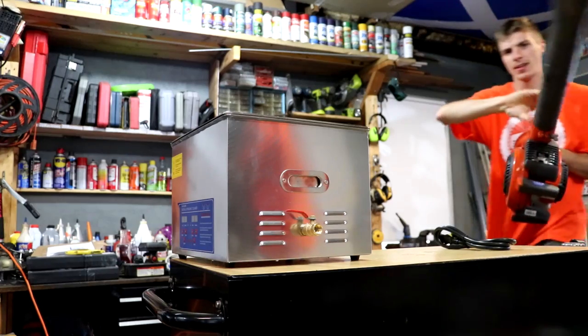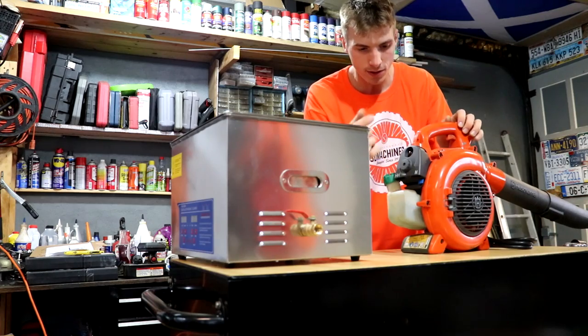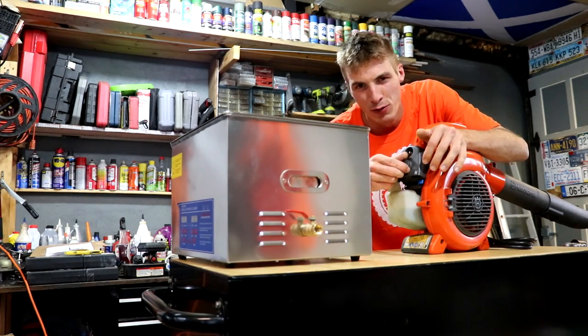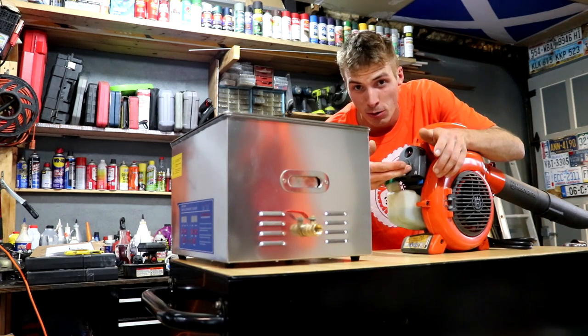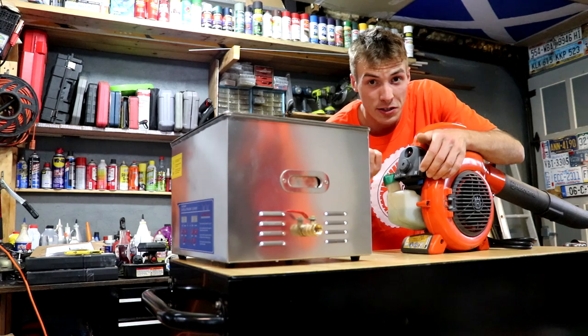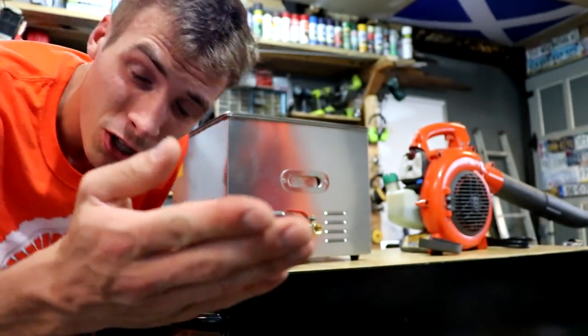Unfortunately I don't have much time today so I can't tear into the GS, but I do have another carburetor that needs some work — something slightly smaller and slightly newer. I think this is a 2015. I bought a carburetor kit for it with diaphragms, a small filter, and parts that are supposed to fix it. I think the problem is there's two-stroke oil junk in there, so I figured this would be the ultrasonic cleaner's first victim. It's quick, it's easy, and it's the weekend — my girlfriend wants to do things and I want to go to Jake's party.